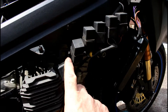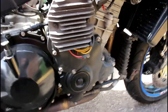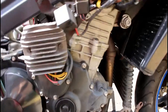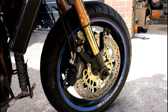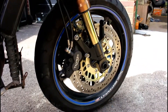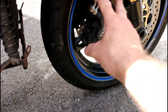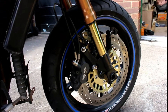Another consideration if you're thinking about making a naked bike: you've got all these relays that you'd have to put somewhere else, and this voltage regulator that you'd probably have to put back underneath the seat. I think it looks very nice with the Hayabusa gold forks — they set off well against the black. The black Triumph calipers look nice too. These are the standard calipers and they bolt exactly straight into the bottoms of these Hayabusa legs, purely by fluke — the Triumph calipers bolt straight onto the bottom of the Suzuki legs without having to do anything.